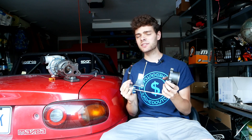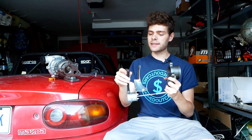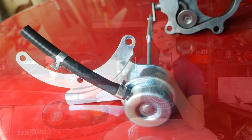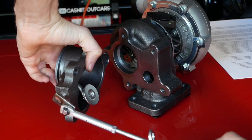So how does it work? This is an actuator here that opens and closes that flap, depending on what boost level you're running in your engine. The way that this knows when to open and close is there's a vacuum line here that under boost becomes pressurized, because you attach that line to the compressor side of your turbo, to your intercooler piping, or to your intake — a lot of people run it directly to the compressor housing of the turbo. Once you hit a certain amount of boost, there's a spring in here with a diaphragm, and as you're building boost, you're building pressure. That's building in this actuator here, and eventually that actuator is going to open when the boost level overcomes the pressure of that spring. Then your wastegate's open, and the exhaust starts coming out of that hole there, rather than spinning up your turbo, and your boost is limited.